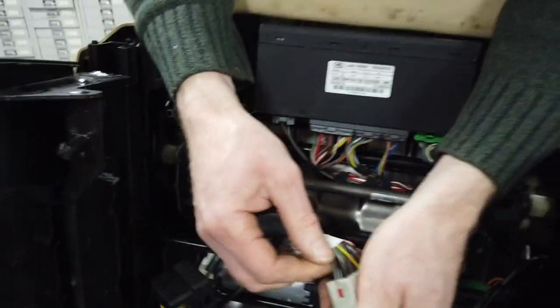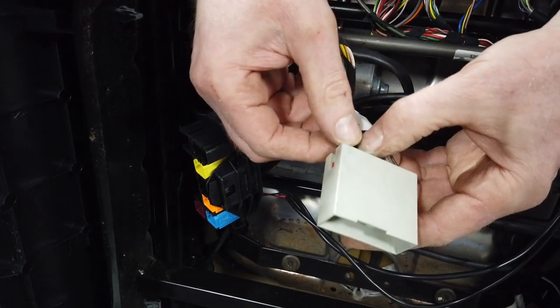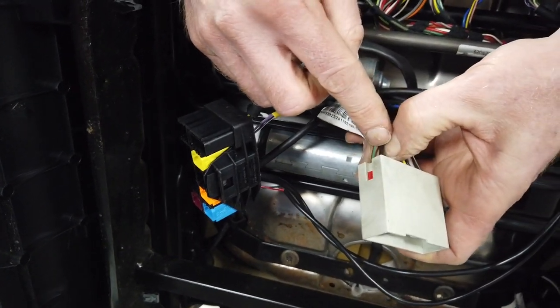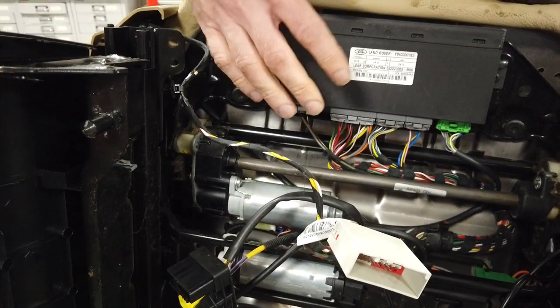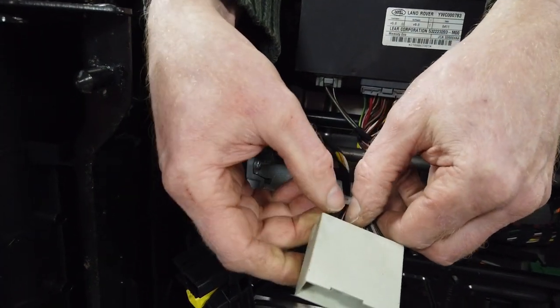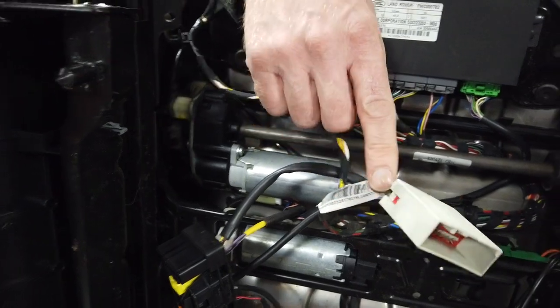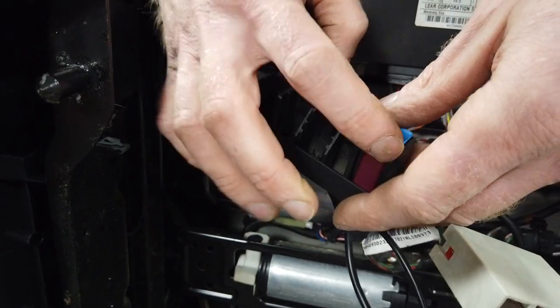The plot thickens when we look at the wiring diagram. We have a big green and brown wire here and a big black wire here. I think if I snip these two and connect them to the big brown and green wire on the car, it might put some life in - because those brown and black wires come up and give power to this control box. If it has power it can see the signals from the switch pack and give the output to the motors. The smaller ones seem to be outputs for mirrors and things - that's what we can work out with our limited knowledge.